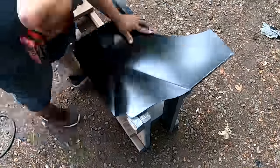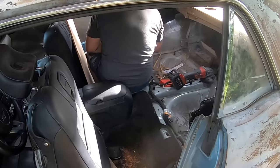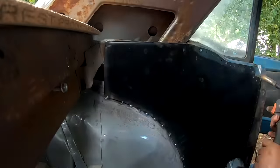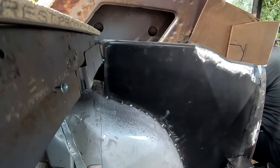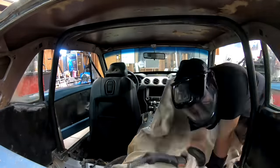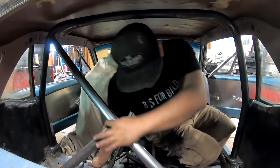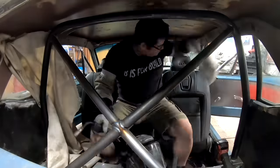While those things cooled down he jumped into some plywood work — we used really dense particle board to build some shelving, and he drilled out a bunch of little holes to weld through for the interior panels, which actually came out really nice looking. He put a little bend in them to help prevent rattling. Now he's welding in the roll cage supports — this is basically a half cage, no door bars like we had in the other Mustang, just a quick-and-dirty half cage. But he really wanted the cross-braced X-bar that a lot of you guys commented on from the last Mustang build, so he got that dialed in. It takes extra time but it was worth it — it looks good.